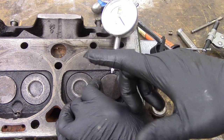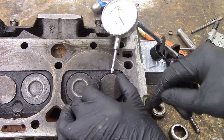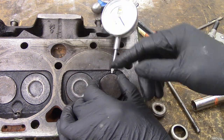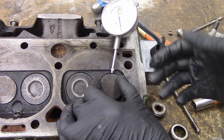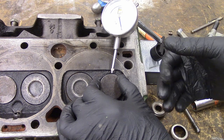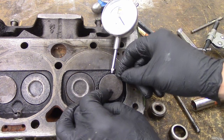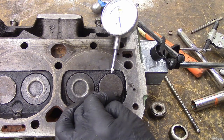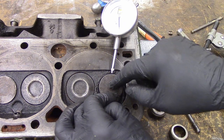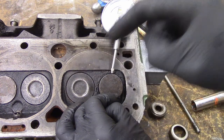So if your specs are supposed to be no more than 0.0027, and we're at 0.0150, this is bad. You can drink a maximum of 27 beer — you just had 150 beer. How do you think you're feeling right now? You're probably feeling red-faced and slurring, face down in a ditch, wearing a poodle skirt with a tattoo that says Mildred, wondering how you got to Spokane. That's how you're feeling with this. These are shot. They can be fixed — we cover how they can be fixed in the cylinder head section of our theory. Make sure you remember that and bring that information with you.